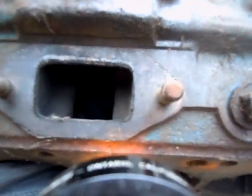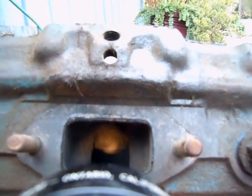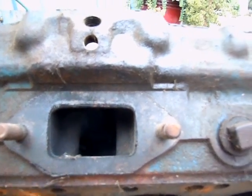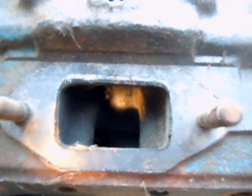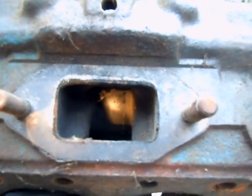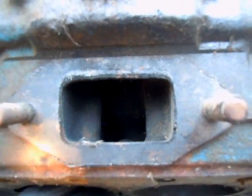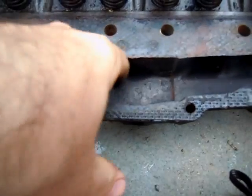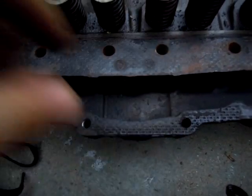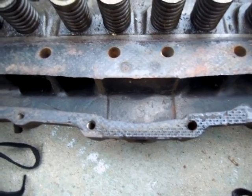If you look at the center port, there's this kind of cavity here — a little raised trough portion up here. What they were trying to do is redirect exhaust gases underneath the trough. The trough is right there; it hits this plate and warms this plate. This is where the carburetor sits when the trough is on it. The purpose of that was to quickly warm the carburetor.